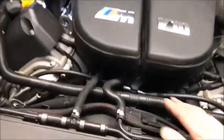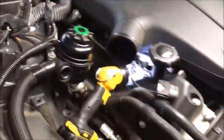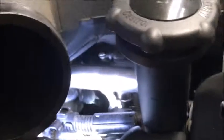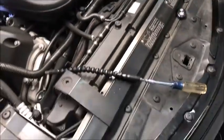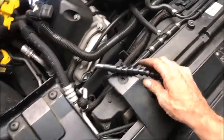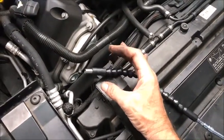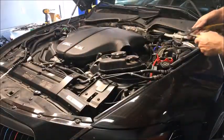Underneath in the front there are a couple of connectors I'll show you, and the other side has one pipe. The hard part is all these little tiny band clamps in here. If I zoom in, right in there is a little band clamp — there's one for each cylinder. The best thing I've found to get these off is this swivel tool. The end of it is a little loose but it fits those band clamps pretty good, so you can twist it up in there and snake around underneath to get those ten off.